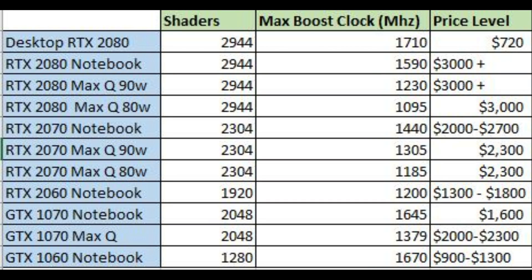On January 29th, Nvidia released their RTX line of laptops, and they are without doubt charging a premium of about $400 to $500 compared to the outgoing GTX models. In order to keep temperatures down in a laptop, they reduced the TDP and clock rates, and they also offer Max-Q variants at 90W and 80W with substantial clock decreases on the 80W parts.